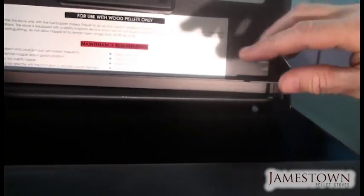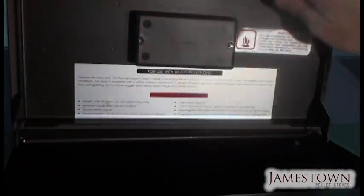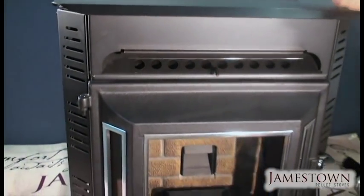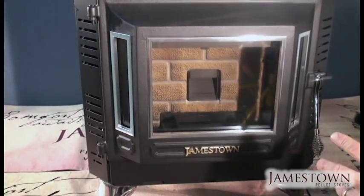Another safety switch is the hopper switch. On our 2009 and later models, when you open the hopper lid, a switch shuts the auger off so no one gets their fingers caught inside the hopper. Once you've filled the hopper with pellets and close the lid, the auger will continue to run. If you fill it while it's burning, that's not a problem — there will be plenty of heat to keep it burning and it will restart as long as you do it in a timely fashion.